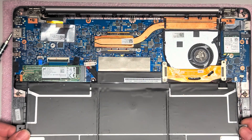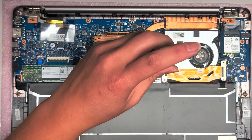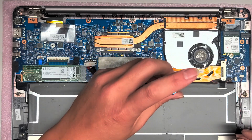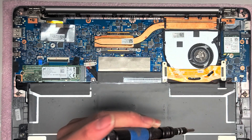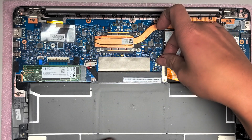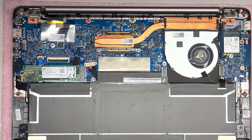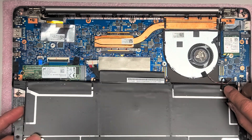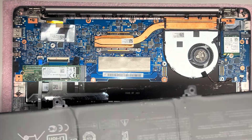Let's see if I can pull this out without disturbing the fan connector, because it looks kind of delicate. To remove that, you pinch the black part of the connector and wiggle it as you pull it out. I have to take out this whole cable — it looks like you have to take out both sides of this cable. Why'd they hide this underneath? That's such a bad design. I guess it's to force people to take it out. Make sure you press and held the power button after disconnecting this. And now we should be able to lift the battery up and out — and there you go, there's the battery.